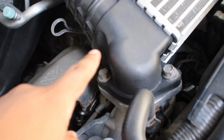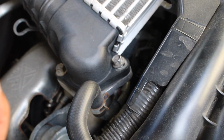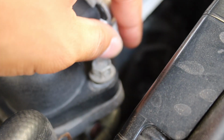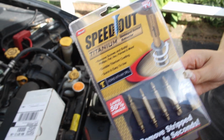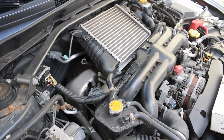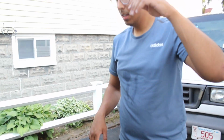As we were trying to remove the bolts, this bolt wouldn't come off. It got loose and then it started getting hard, so I'm like, it definitely cross-threaded from when I needed to replace my clutch, and so it snapped straight through. So now I bought this hoping I could be able to take it out. If not, I'm going to have to go to a mechanic, have him weld a nut onto it and then remove it like that, but we'll see how it goes.